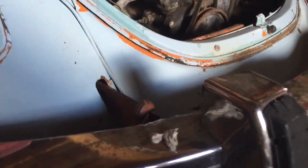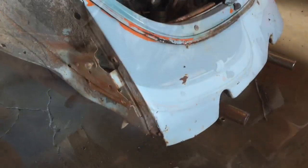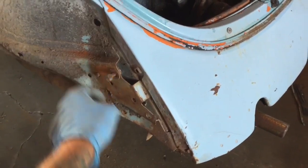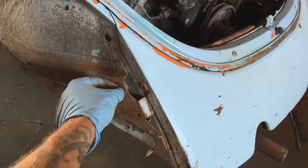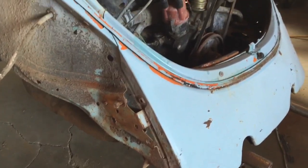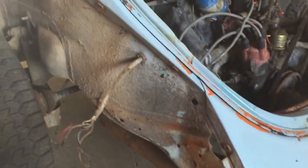The first step for taking the engine out is removing the bumper and making the rear apron removable. The bumper was held on by one bolt on one side and two on the other, on this flange right here. I also got the fender off. This thing had some really rusty bolts — it took a long time, and I ended up using a hacksaw blade on one of them that was holding the running board on.